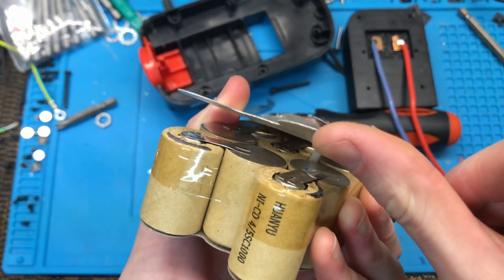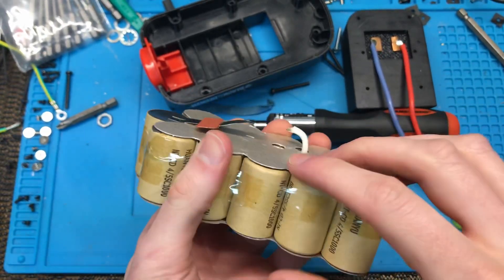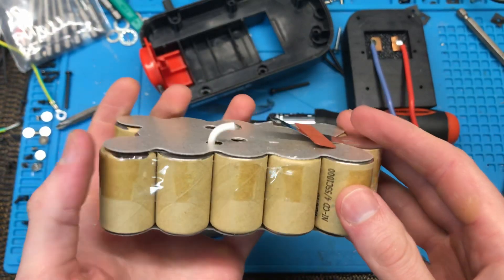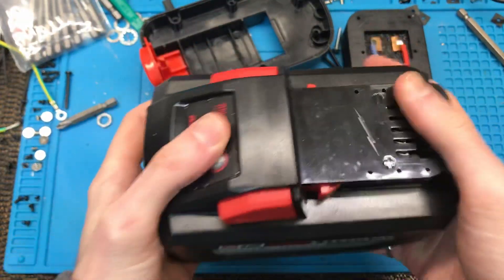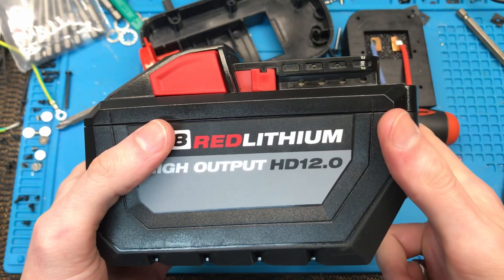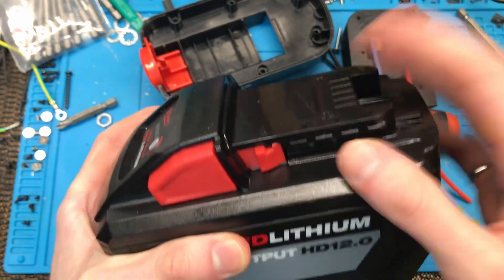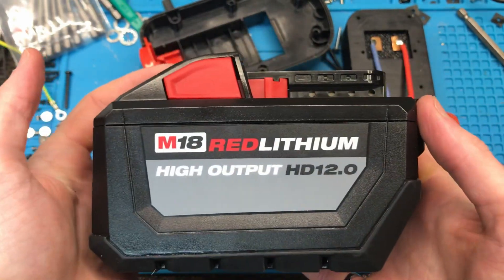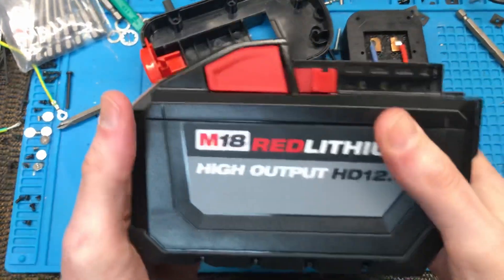So here's how they did it back in the old days. Every cell is in series, none are in parallel. There's no fancy smart charger that controls how much power each cell gets during charging to make sure that nobody gets over-voltage. You just kind of had to time it - three to six hours of charging they say. There's a lot more smarts in the Milwaukee battery. Unlike most other major brands of tool batteries with lithium, they don't have under-voltage protection in the battery for the Milwaukees - it's in the tool. Most other brands it's in the battery. So we'll have to be careful. But this is a 12 amp-hour - it's probably never going to run out with this super cheap drill. This is normally for my chainsaw.